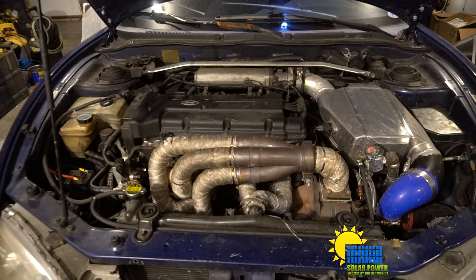Unfortunately, what happened is my brake light switch got triggered on for at least a year and a half, and that killed that battery and the battery in the trunk. They're both pretty much totally gone — not recoverable. That puts me in a position where I'm tired of buying batteries.